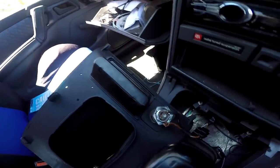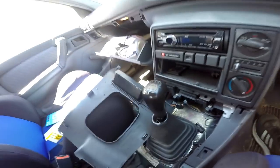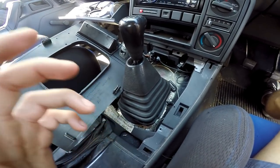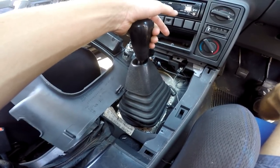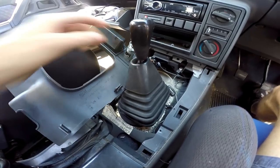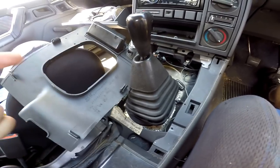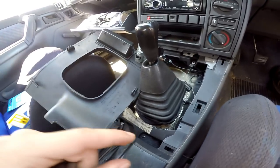I also have to solder this cigarette lighter back on because it kind of came off. Basically my gearbox has been leaking fluid out from where the tail shaft goes in. I noticed the other day it's starting to crunch gears — third, fourth and fifth if I shift too fast. It's definitely getting low on fluid and I'm pretty sure it's going to blow up soon. I do have my rebuilt one sitting in the storage container ready to go on, but it also has a leak from the same spot, so I have to get that fixed first.